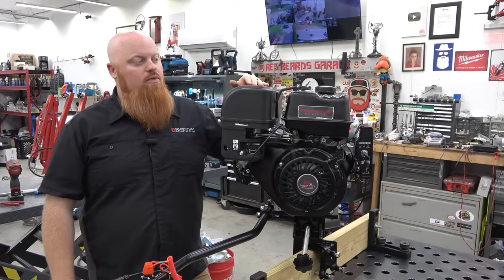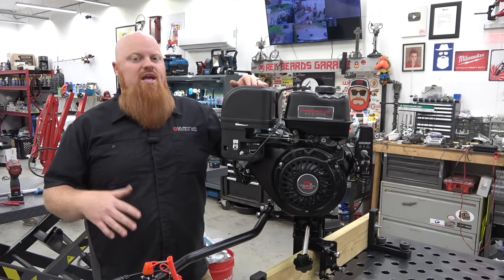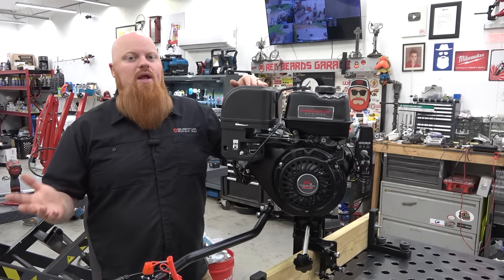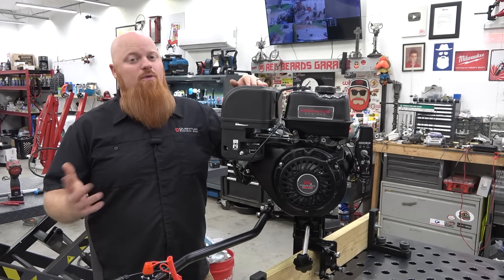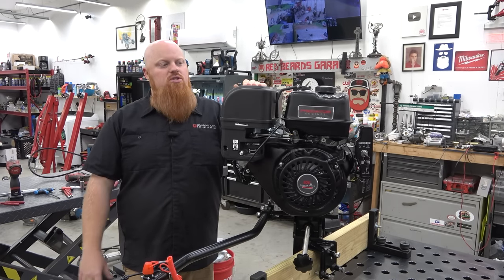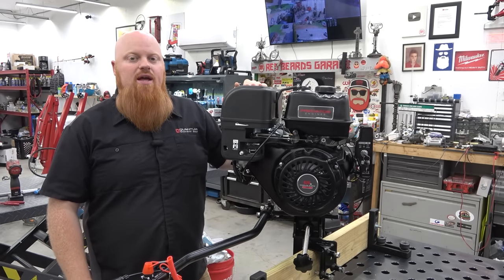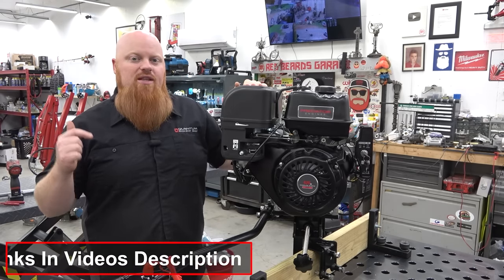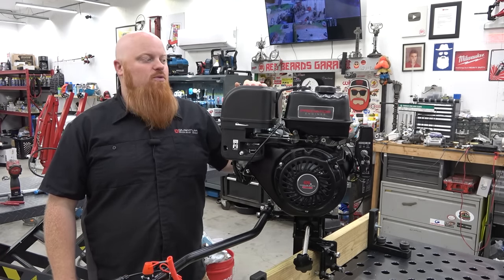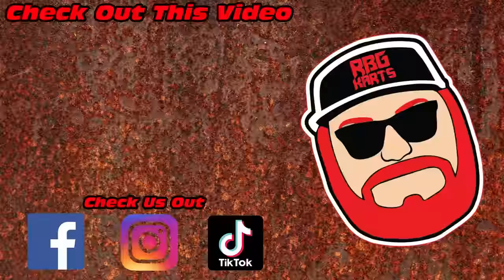We don't want to do much more than that — when we built up the engine on the 7 horse kit, we added more problems than anything because that kit was designed for around 7 to 9 horsepower and we were pushing about 14 with it, which started wearing belts faster. So we're mostly just doing longevity parts and bumping it up maybe 3 to 4 horsepower. Stay tuned for that! Thank you so much for watching — check out the links in the description for all the parts, and stay tuned for the boat reveal and build. We love you guys, God bless!